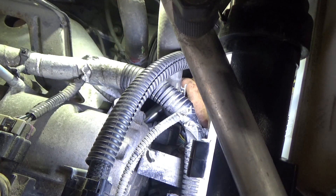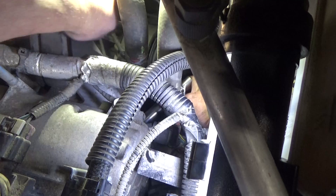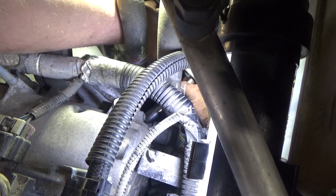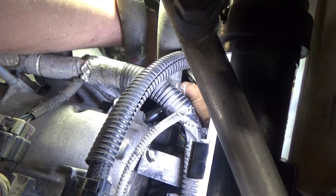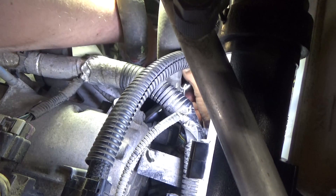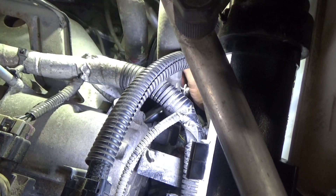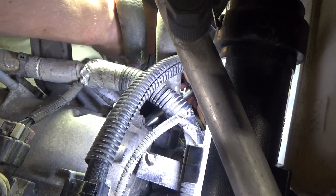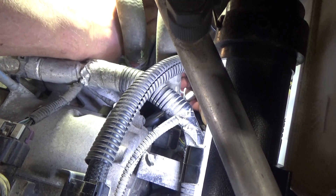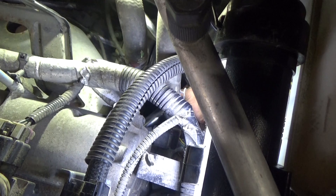I feel good about that — I can feel the resistance of the thread seal. I'm going to go ahead and put the ratchet to it. After we get done with this, what you're going to want to do is run the vehicle, then top off your antifreeze. We did lose a little bit — obviously the faster you do it the less you'll lose, and releasing the pressure was a good thing. You don't want to go crazy with it; you don't want to break anything, but you don't want it to fall out. I'm right there — we're just going to snug it up. Incidentally, I'll link to this part and the code scanner I'm using in the description below.